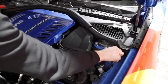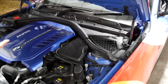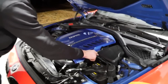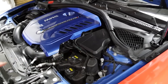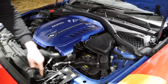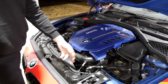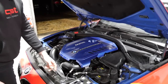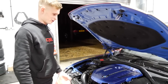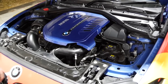The vacuum pipe runs from the glove box into the controller — that's how it picks up its vacuum pressure. Then you've got the meth pipe, which runs all the way from the boot through here, routed and hidden. This is a 500cc nozzle, which is one of the smaller nozzles, tapped in there. It looks pretty OEM really — unless you knew, you probably wouldn't know at all.